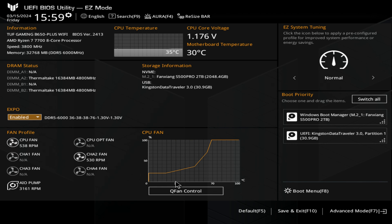You can go into fan control, which we'll do shortly, and make modifications to the fan profiles. Over on this side you've got the easy system tuning — you can go through and choose various methods of tuning your system, such as PBO enhancement or normal. I actually prefer to leave it set to normal. PBO enhancement does seem to apply a little bit too much voltage and is a little bit more aggressive, giving higher temperatures. So I would suggest leaving it set to normal, but play with those two settings and see which works best for you.